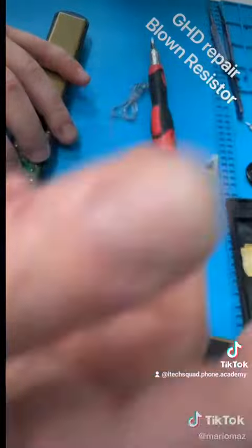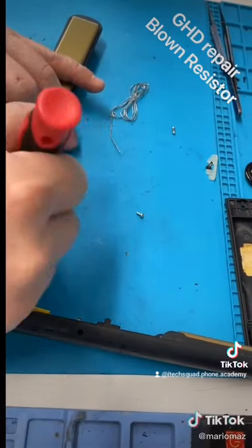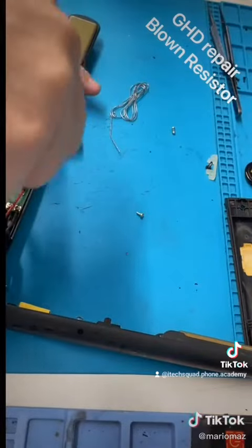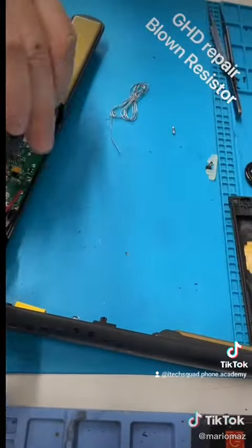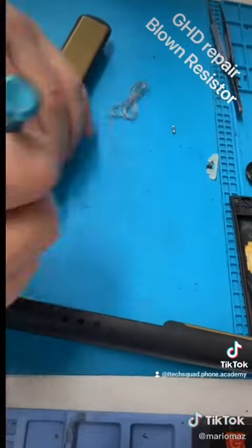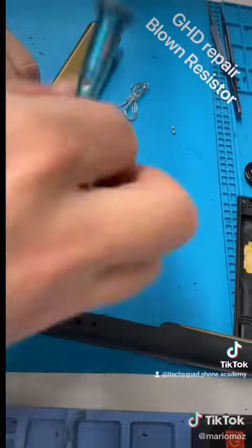That's not going anywhere. I'm pretty confident it will be good to go, so we'll just quickly assemble it, get it tested, and see if it comes on. When it comes on, we'll make sure it gets to the top heat — the safety cut-out will indicate it's at the top heat — and then it won't carry on getting hotter and hotter and blow the component again.